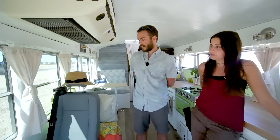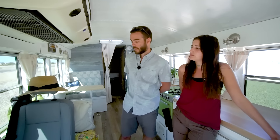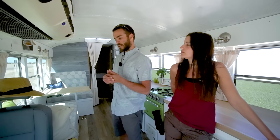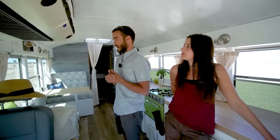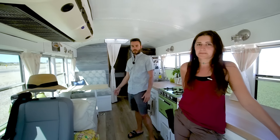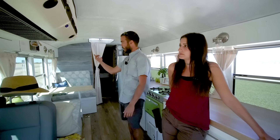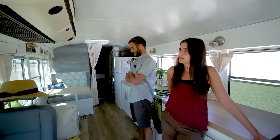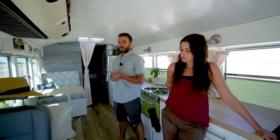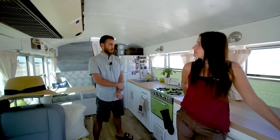The walls of the bus are two-by-four framing, then two-by-twos going down to another two-by-four going across on the bottom, and then just Luan paneling. Inside is the pink foam board insulation and the wiring for the outlets and lights. The lights are 110 with LED bulbs — they draw four watts an hour, we have three of them, and we barely ever use them. Normally at night we just have the one LED light bulb. Most of this bus is 110. We have three things that run off 12 volts: the toilet fan, the water pump, and the RV furnace.